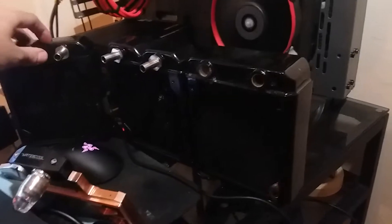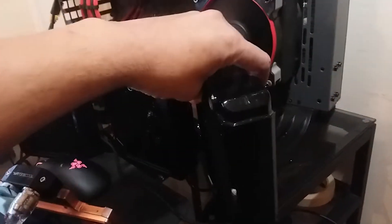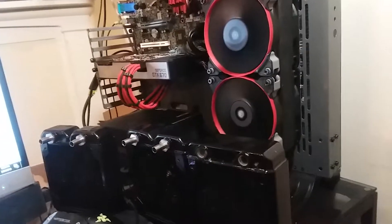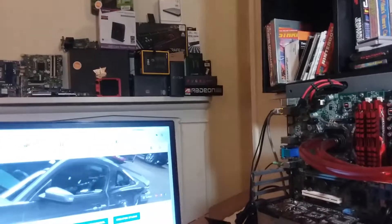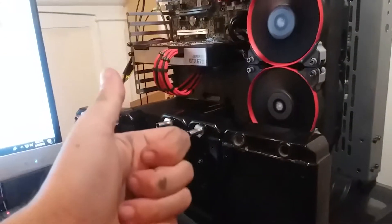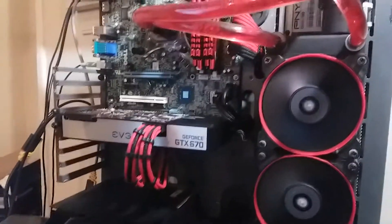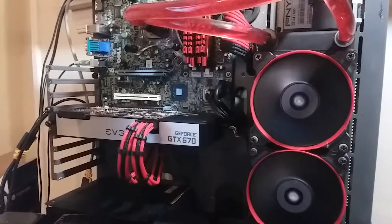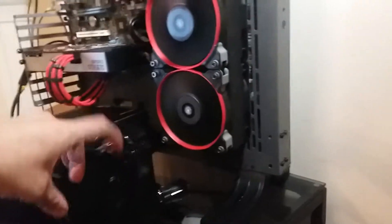And these are like knockoff Nemesis radiators — don't know the brand, don't care. This one's super thick though, so that's cool. So I now have five radiators that I can interchange, because you've got the red one up there from the original GPU pump for the 580. So I'm all set for any kind of system I want to put together. There is a little bit of degradation by running in that bottom slot, because it's not an actual x16 slot — it's actually an x4 slot, which is a problem, but until I get another motherboard, it's what I have to deal with.